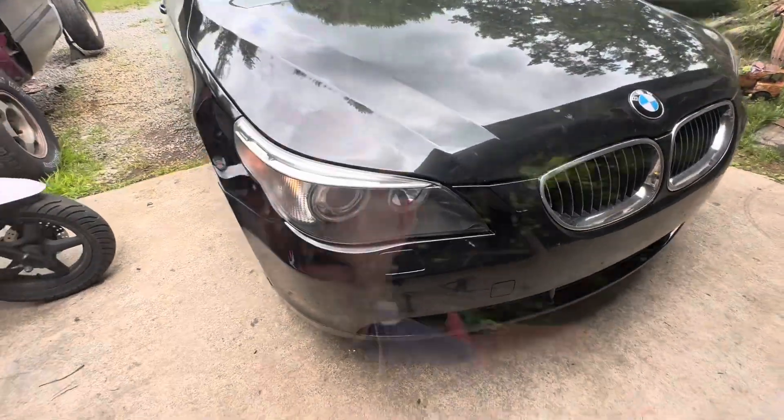So that's the headlights on a 2006 BMW 530i — removal, sanding, reworking them. If you have any questions about what I did please feel free to message me or leave a comment. We started out with 1500 grit — my water was not just plain water, I actually had a little bit of dish soap in it. For some reason when you add just a little bit of dish soap to your wet-sanding water it makes it work so much better. I've heard several old-timers talk about doing that.